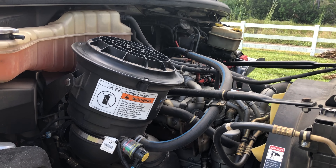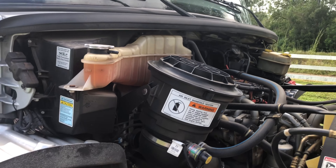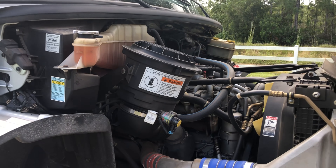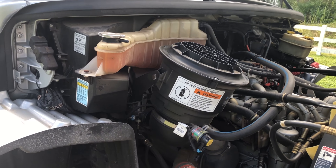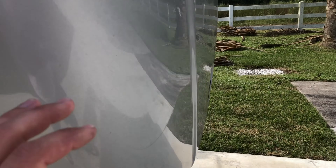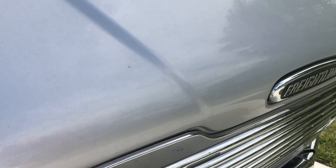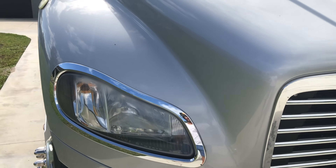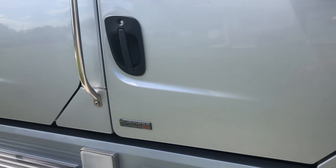These are also a lot of RV guys — they're not putting half a million miles on their trucks. There's a million of these trucks out there, so you have guys that are work-horsing them, and they talk about losing coolant. But if you send the coolant into the engine, the problem is you start diluting your oil, and then you wear out your bearings.